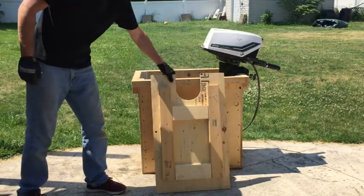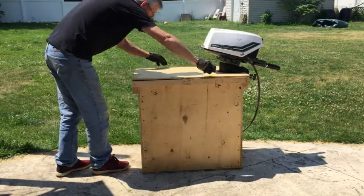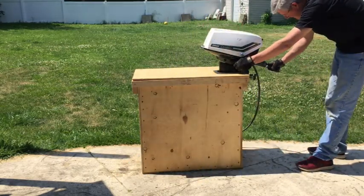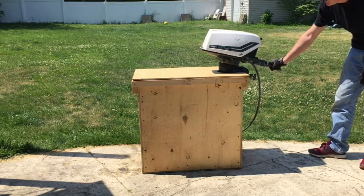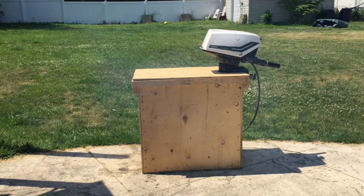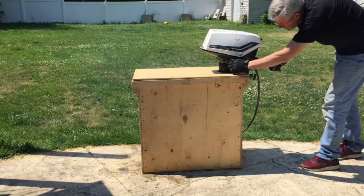There's the lid I made. Keep in mind that lid was not part of my half-inch sheet of plywood — that was some scrap three-eighths inch I had left over. I attached some spruce lumber just to stiffen the lid and to add some weight and keep it from bouncing around on the test tank. The hole you cut out in the lid for the engine to fit in is something you'll need to check — I didn't give any dimensions for that because you'll need to make sure it fits your particular outboard motor, so leave that till the end. You don't want to cut it too tight, and if you have several different outboard motors in mind, make the hole for the biggest motor you intend to use.